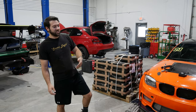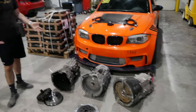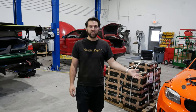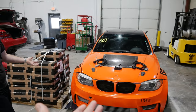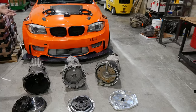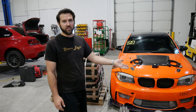It's stupid fast in the Supra, it's stupid fast in F30s. It can hold the power, which is a big concern. If you just have a normal B58 auto, you can't actually control the internals. You can get a flash and stuff like that, but you're still not going to be able to hold big power. HTG can increase the pressures with no OEM limits. These are proven to hold over 600 foot-pounds of torque — 650 foot-pounds.